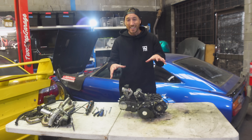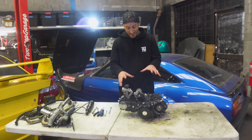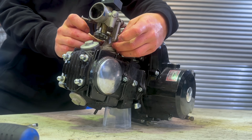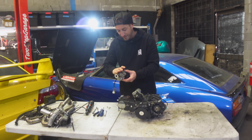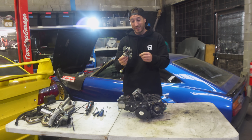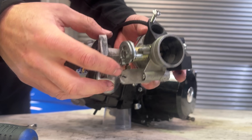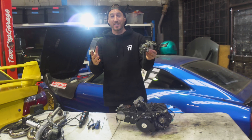It's finally time to pull apart our 125cc motor, and this is the part I'm most excited for. I don't actually know a lot about these motors, so this is a really good opportunity for us to learn as we go. First up, we're going to take off the intake manifold — just two 10mm bolts. One big thing about these motors is the intake manifold is really skinny and seems quite restrictive. I port matched it a little bit, but there's definitely a lot left on the table in terms of how much air we can get in, especially through the throttle body.